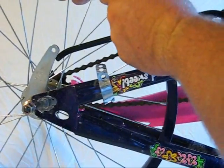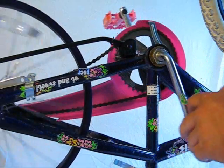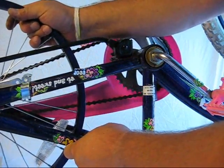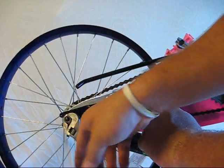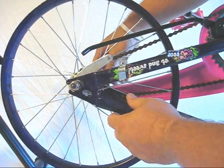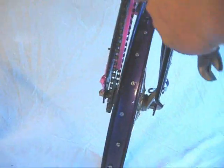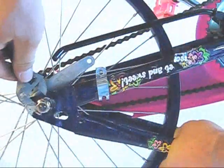Put the wheel on, make sure your axle is seated, and make sure your front sprocket is on. You can see the wheel is turning — the chain is really loose right now. What you want to do is tighten up the chain by moving the wheel back. The chain looks nice and tight now. Snug up one nut just a little bit, not all the way. Once you have both sides snugged up, make sure the wheel is aligned by checking that the spacing looks the same on both sides — that means the wheel is straight. Tighten the nut down all the way.